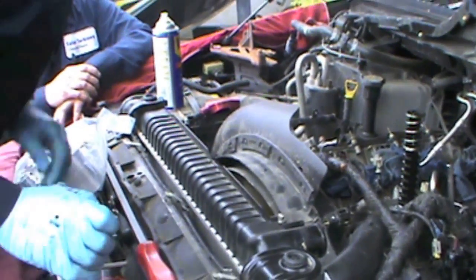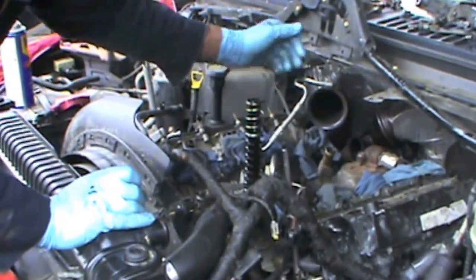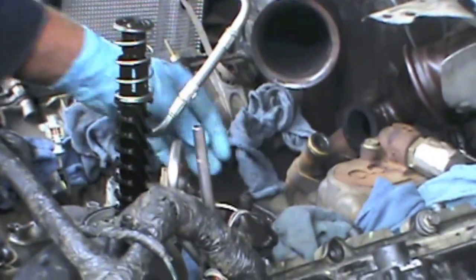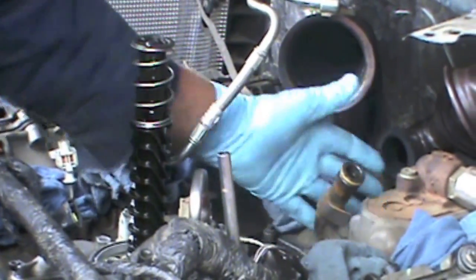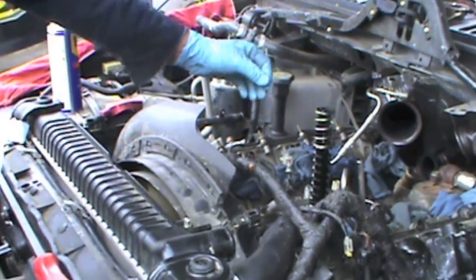First, I'll take something, I'll scrape along the edges here and then I'll blow it back. Another thing too — your turbo drain back tube. I put that back inside there so I'm not blowing everything back down inside the oil. So anyhow, that's my pointer there.